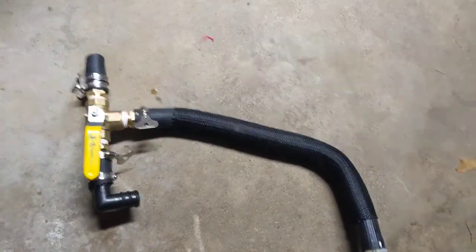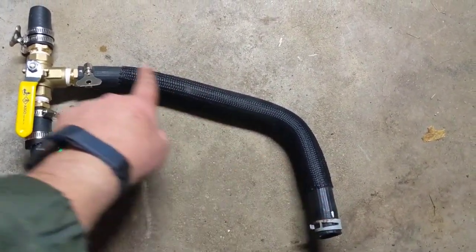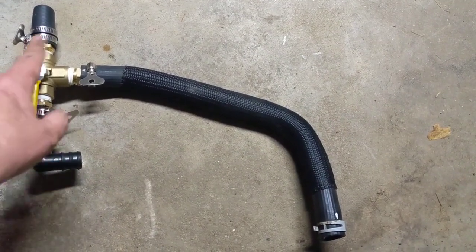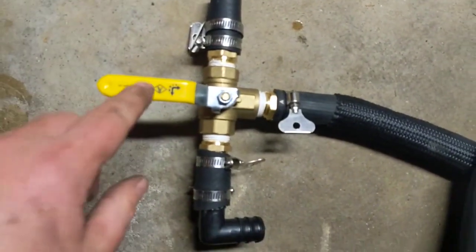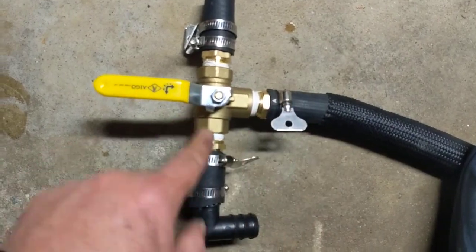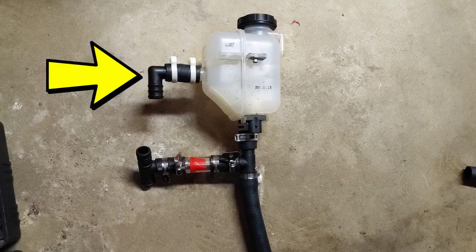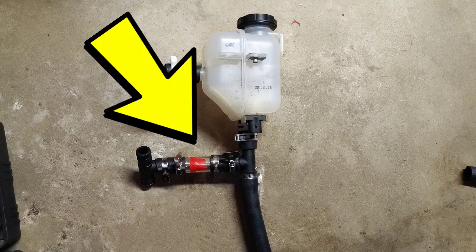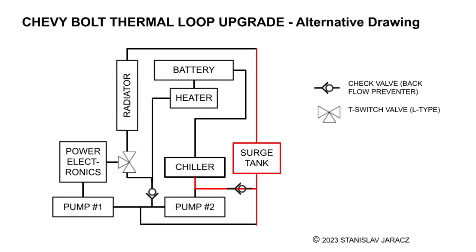This is the assembly with the valve. This is coming from the end of the powertrain, from the motor. And here, this will go to the battery — there will be another piping. Right now this is in the summer position, which means that from the powertrain it will go to the radiator. For winter, this is the winter position — from the powertrain it will go to the battery. This is the surge tank on the front passenger side; the inlet is coming from the upper part of the radiator, and the outlet goes down to pump number one. This section with the check valve is a connection between the battery coolant line and the powertrain coolant line. The section of this drawing highlighted in red represents the disassembly.